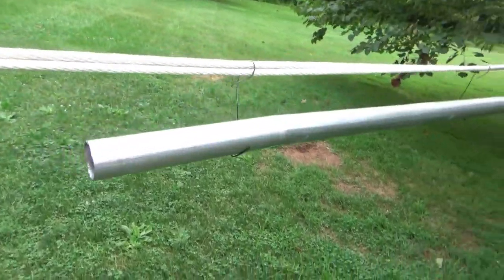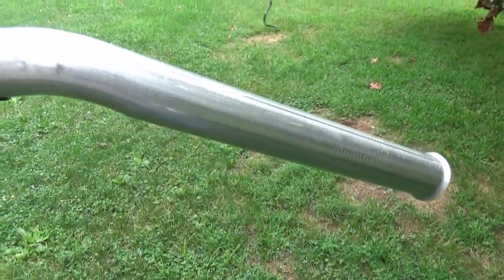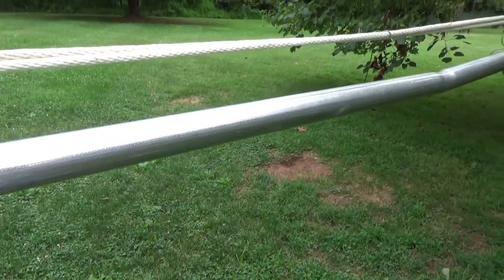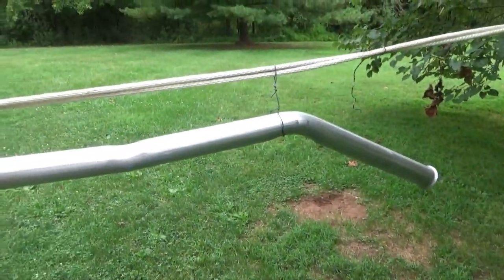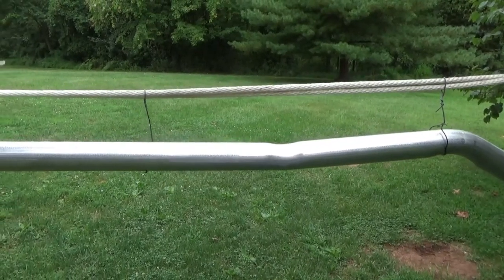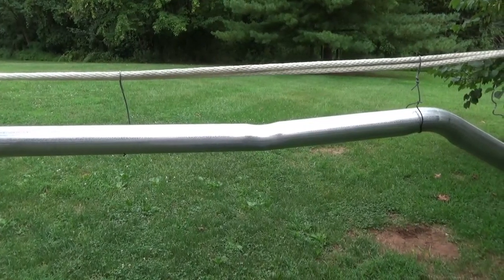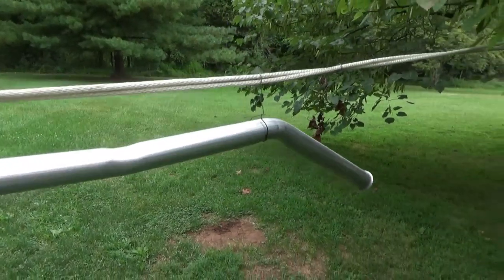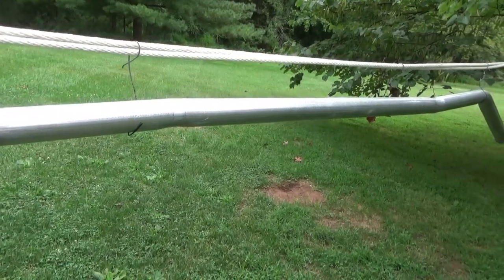All right, guys, so there's the exhaust pipe. Not sure if this is galvanized or not. We got this new, I think from Lang's Old Car Parts. But I don't know if it's galvanized or not, so we're going to just clear coat over that. This is an engine enamel, I can't talk today for some reason. It withstands heat up to 500 Fahrenheit. So we're going to put that on there. I don't know that it would get higher than 500 degrees, but we're just going to throw a coat or two of this on there, and then maybe we can put that on the car, I'm not sure.